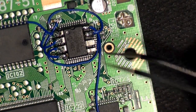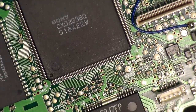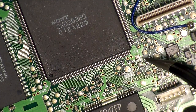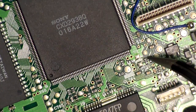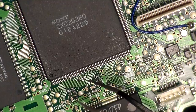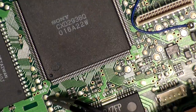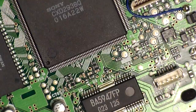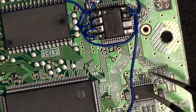Pin one is done. Next, back at the mod chip, we'll solder in pin eight — that goes down below the ribbon cable socket and solders to the middle solder joint there. That's pin eight done. Now all we have left are pins five and six. Those two solder points are right below the large processor. Pin six is on the side of this small resistor facing the big processor chip — on the left-hand side. Pin five is on this solder point, the first one in this row of three — the top one.